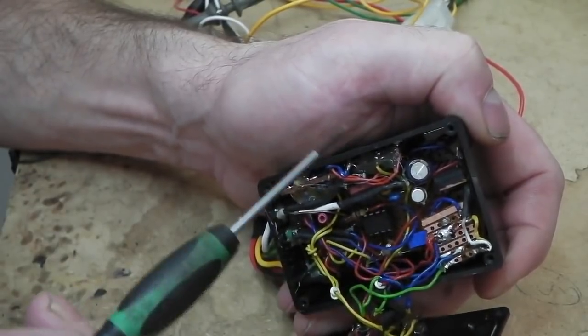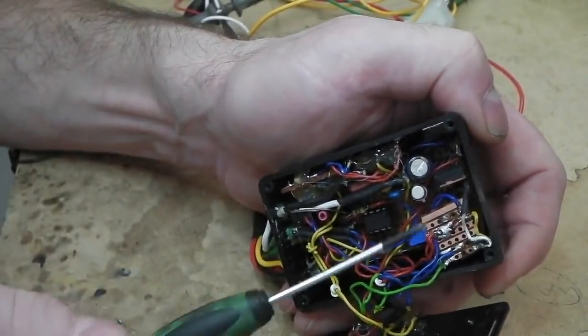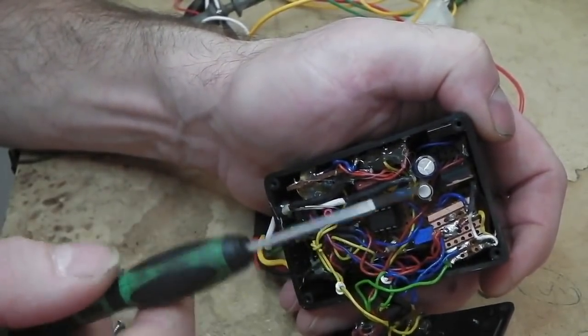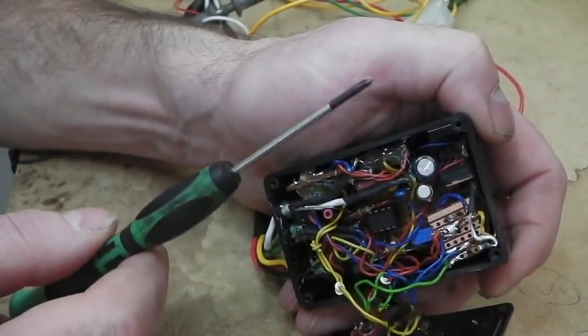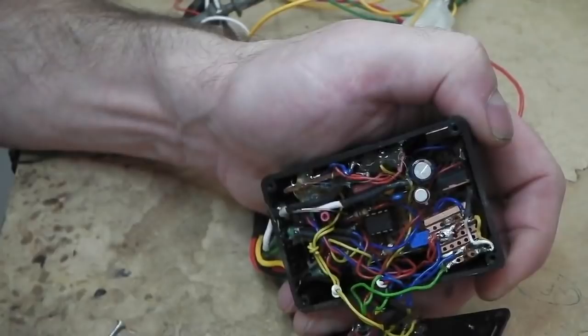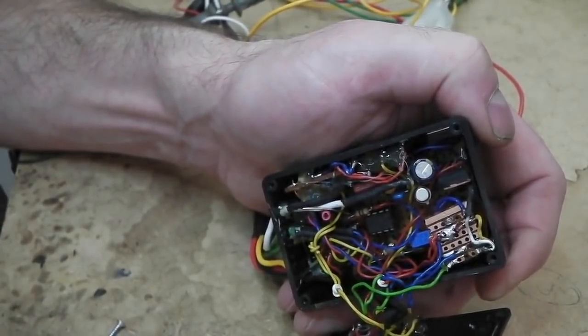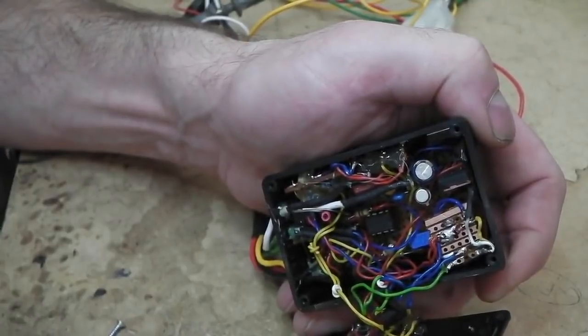That means that if my battery got as low as 10 volts, this will still work and won't start going crazy. I would not want to hear all clicking relays going off in here. So that's it really. Most relays actually, on a holding current, will drop as low as 5 volts before they release. So you can try that at home if you don't believe me.